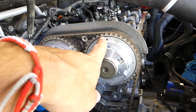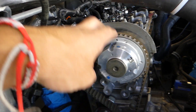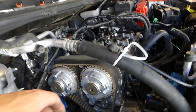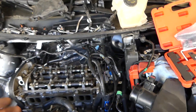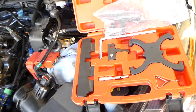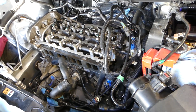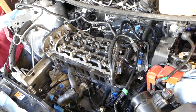If your timing is correct, you'll have that dot facing up on the intake camshaft and the exhaust camshaft, with that groove pointing up as well. For the Volvo engine specifically, the method will be a little more difficult — you'll also need to use another tool that holds the flywheel through the starter hole. We'll have a video for that as well. Many more videos to come — thanks for watching, see you next time.